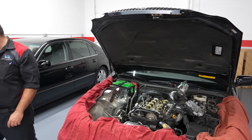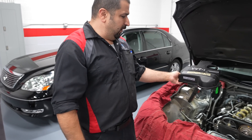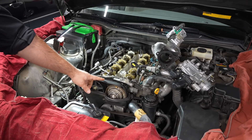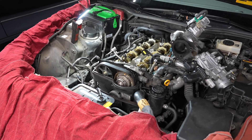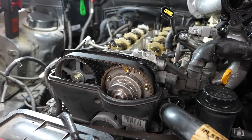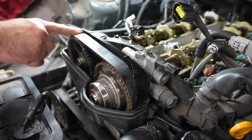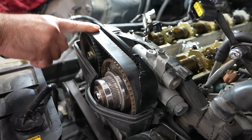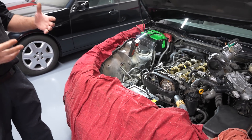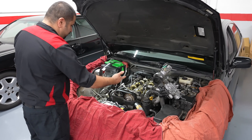Of course, it's a timing belt engine. Another cool thing — you can easily pull this front cover. It just sits here and you can see the condition of the timing belt. Most engines you can remove some type of cover, but some are more complicated than others. This one is super easy — four bolts, comes right out, and you can see the condition of the timing belt. This timing belt looks decent. The owner is planning to replace it in the near future, but it's a nice thing that you can actually see these. They're very simple.